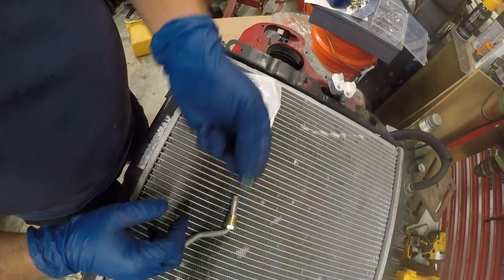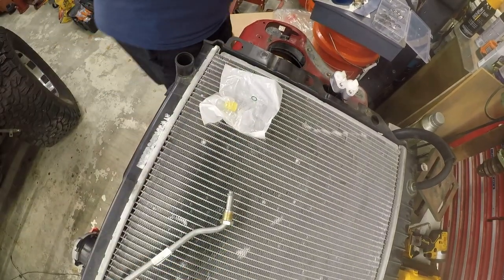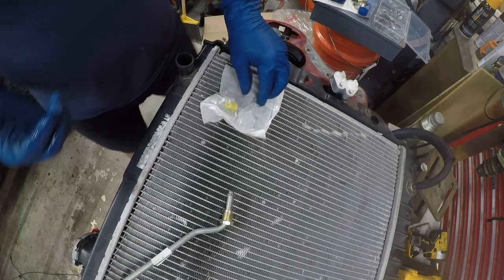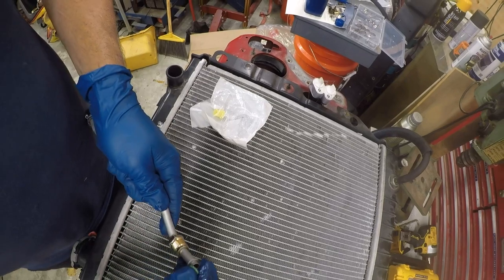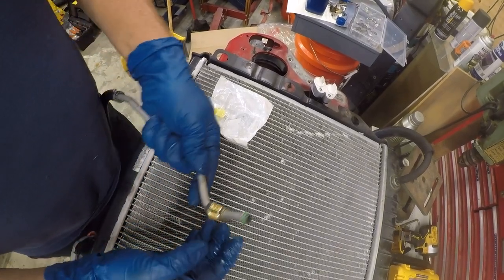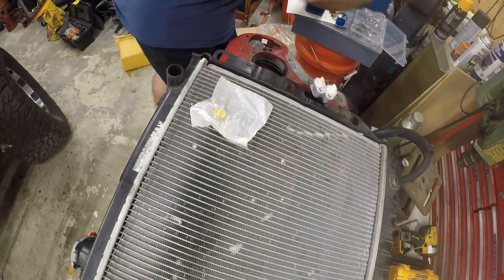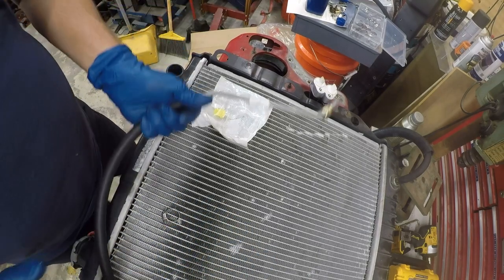There's a little tiny O-ring that goes right here, and the best thing to do with this is to lubricate it. And the oil for this is just power steering fluid. So we've applied that, now we're ready to go. We just need a clamp for this. So any old Chinese clamp will do. That one looks fine. So I'm gonna change gloves and put it back together.